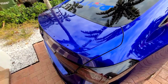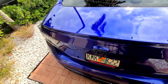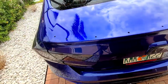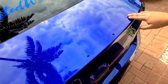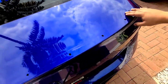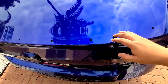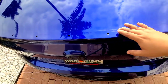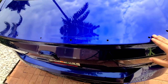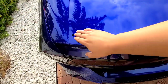All right, guys, I went ahead and already cleaned it the most I can. You may see a little bit of residue here and there, but that's not a problem. It's very thin. What you want to make sure is that you have a clean touch feel. The reason I'm not cleaning this off any further is because the other spoiler is going to rest on here. And I'm going to put some adhesion promoter here, so it should take off the rest of the adhesive that you see here.